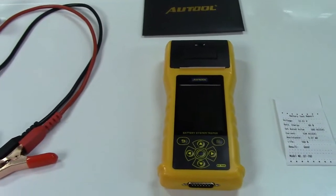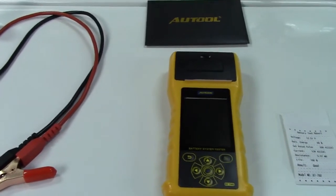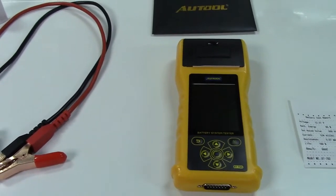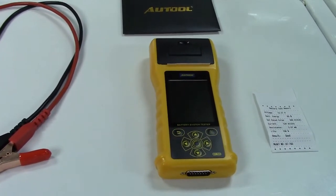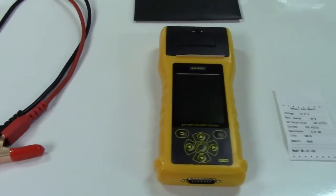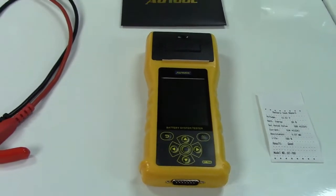I'm going to tell you a little bit about the tool, and then we'll go and test it out. This is good for automotive batteries. It's going to do a battery test, a cranking test, a charging test, and a load test. It'll handle batteries from 100 to 3,000 cold cranking amps, and it'll work with all different types of batteries: regular flooded, AGM — both flat and spiral varieties — gel, and EFB batteries as well.